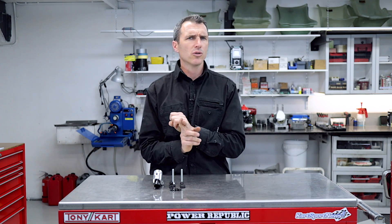Now we've run you through some of the benefits of this new engineering piece of equipment and we're going to show you how to fit it up to a Tony Kart. Before we can install the new components we need to remove some parts from the kart: steering wheel, steering wheel boss, steering column support and hardware, and the toe rods.